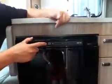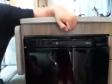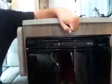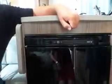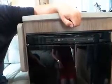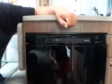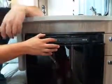To adjust settings, hold the gray button down for a couple of seconds and it'll flash so you can change the power supply. It runs on gas, vehicle battery, or electric. To set it on electric just press the gray button again, then set the temperature — five is the highest and one is the lowest — then press gray button again to confirm. The screen will stay lit for a few seconds and then go blank, because it's designed not to be a bright light at night.